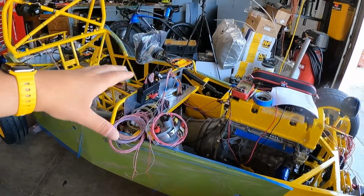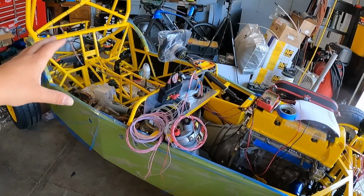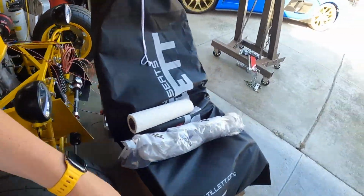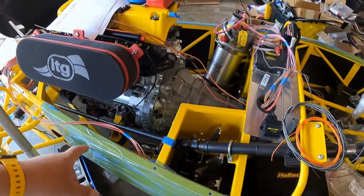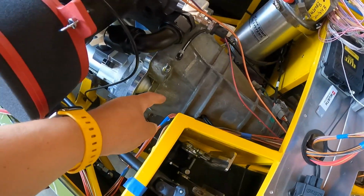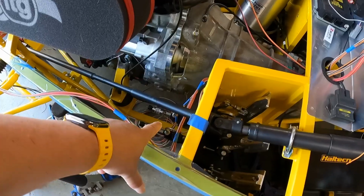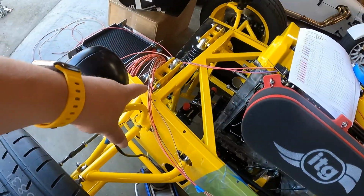I've run the wiring, separated our groups, and really what we have here is 3 groups going on. Well, technically 4, but we'll say 3 main ones. So there's a leg that comes up here, and actually if I come around to this side of the car, I can show you my routing. So we have one leg that comes down, it'll follow inside of the tunnel here, make the corner where it'll have a branch that goes down to pick up our sensors on the brake and clutch, and then another leg that comes up. It's going to follow the chassis rail all the way forward.